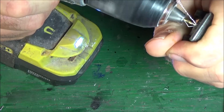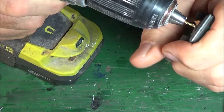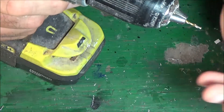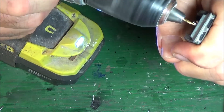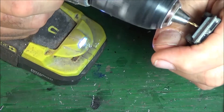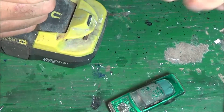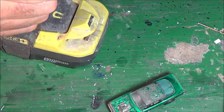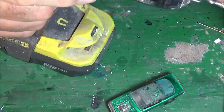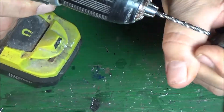Always keep your bit clean or it'll bind — you could break it off in the post, then you have a problem. Drilling the front one out now. The front one on this is shallow because the front post actually goes up under the motor, and the bottom part of the motor is right on top of the post. Once we drill the post out, I'm gonna go with the larger bit to remove the mushroom. It's actually a little too big of a bit, but it's all I got right now.